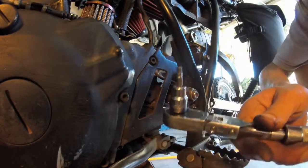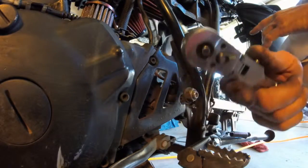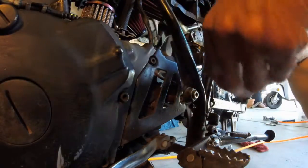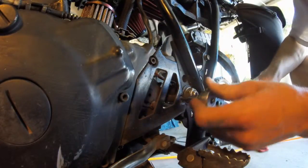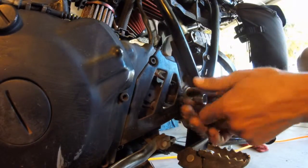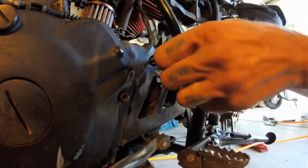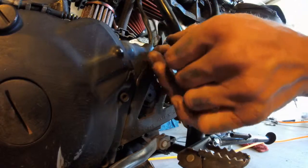A metric Allen key socket. Alright? Metric. You can't use standard. You're gonna strip everything. This is a Yamaha, means it's foreign, and they're gonna be using metric. Everybody says, oh, I think I can unscrew it with just the Allen keys I got in my house. Next thing you know, you've stripped every damn screw on your bike. And never over tighten anything on your bike either. Some of these plates on the engine are magnesium, sometimes aluminum, and they strip very easily.